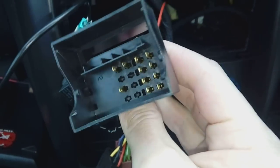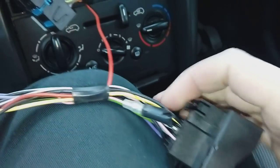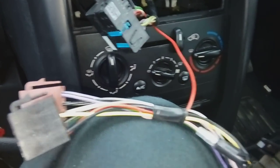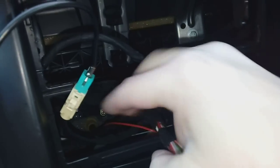You're also going to need a wiring adapter with a power feeder. It comes off your quad lock adapter. This is for an ignition-switched power supply — without it your radio will not power up, and if you wire it directly to power it's going to flatten the battery overnight.